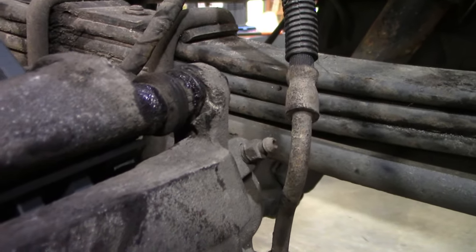Just a little reminder: anytime you do brake work on your vehicle - doesn't matter what vehicle it is, replace the pads, rotors, just the pads, whatever - before you put it in gear, start it up and pump your brake pedal nice and slow three, four, or five times to get everything seated back out against the rotors. Because if you don't, even though you put your foot on the brake and drop it in gear, you may go for a ride. Just a friendly reminder tip from the bear.